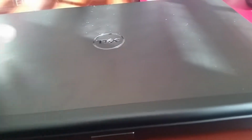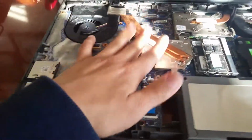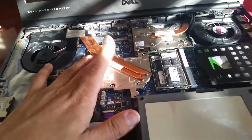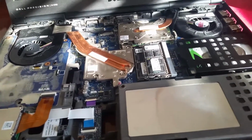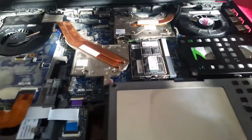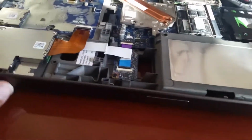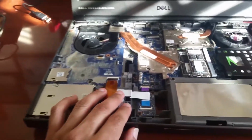So I'm just gonna move this to the side. Move the laptop itself towards us. Right there. Push the button. So, as you can see there, that's the inside of the motherboard. Currently, it's got an i7-3840QM, 2.8 GHz. It can turbo up to a 3.8. It can, supposedly, but the maximum I've gotten is at 3.56. It's got a Quadro K2000M, 2 GB of DDR3. It's got 8 GB here and 8 GB on the back, so 16 GB. Got a Barracuda hard drive, 1 TB, and yeah, so let's put it back.